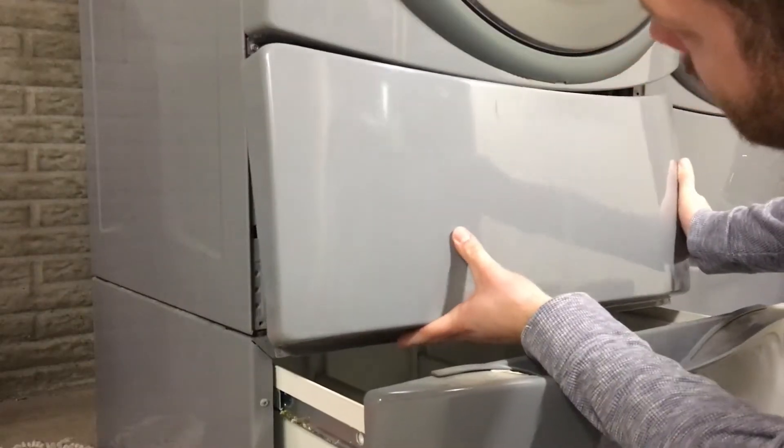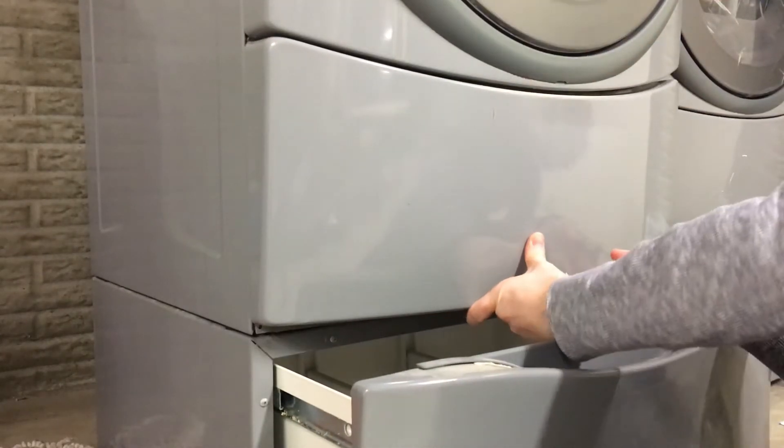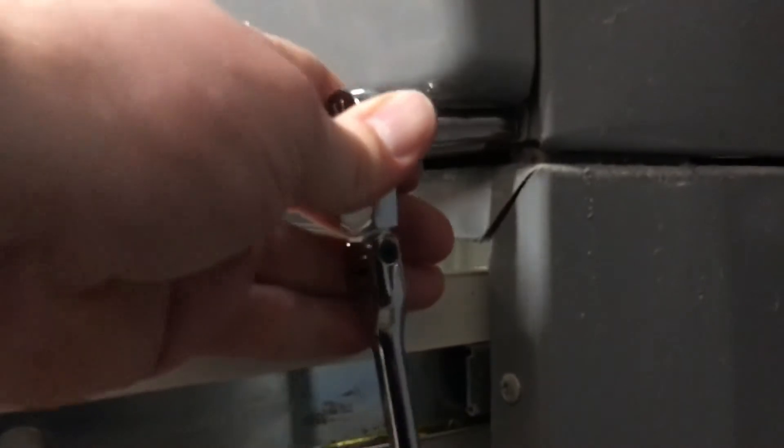Okay, it's been a few days. The washing machine has not leaked at all, so the cheap fix worked. I'm going to leave it like that, and if it leaks again then I'll look for a replacement hose, but for now I'm happy. I'm going to put the bottom cover back on — 7mm ratchet — put the top cover back on — same 7mm ratchet. Pretty easy.